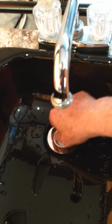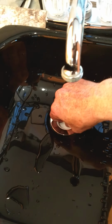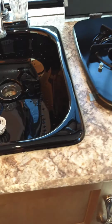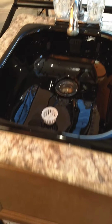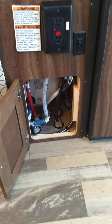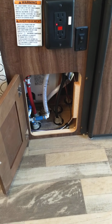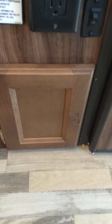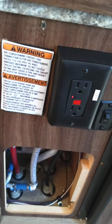Just so you know, this drain screws into place. So if you have it shut, when you turn on the water outside, make sure your taps are off, because it'll overflow quickly. I mentioned that you have to bypass the water heater before you winterize it. I can give you a general idea of how and where you do that. There's a door here with hinges on it, but it has a screw and is actually screwed shut. I've unscrewed it so I could show you this.